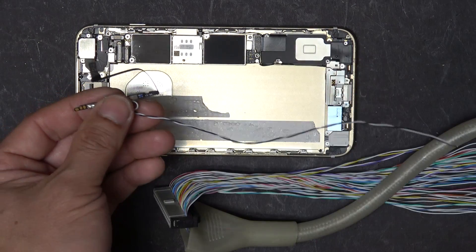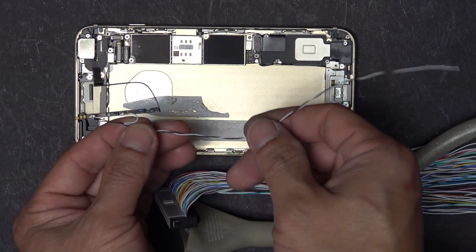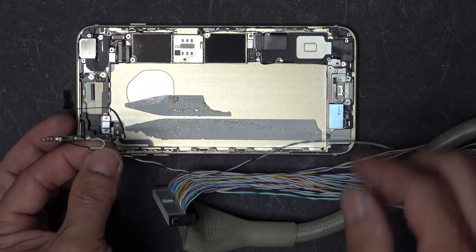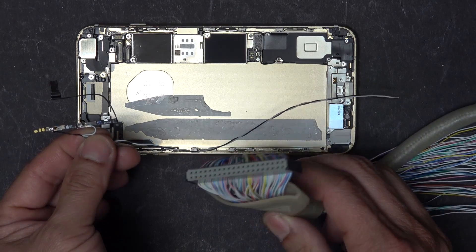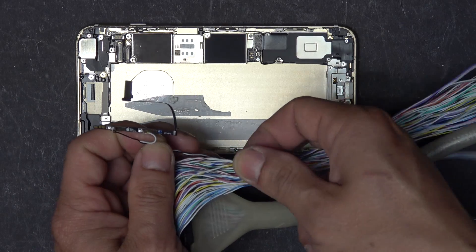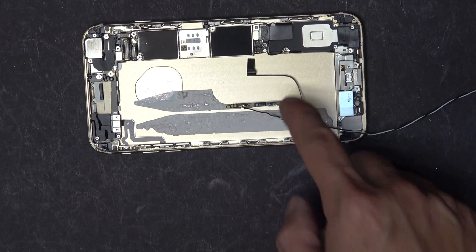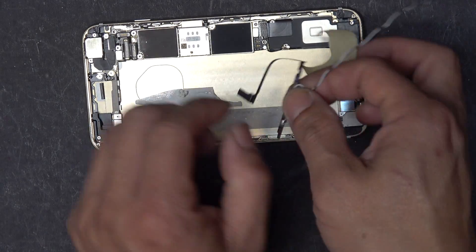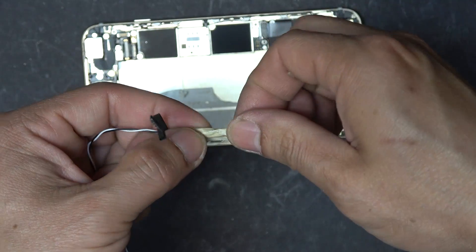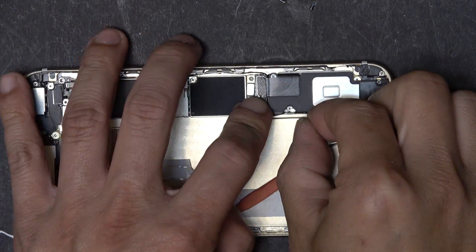That's where I connect to the external battery. Because the phone doesn't use a lot of current, I can afford to use a very thin wire — I want to use as small a wire as possible so that it doesn't look conspicuous. I use wire from an old IDE hard drive, which has very thin and small wires — perfect for this. The BMS is going to lay right on the aluminum, so I need to insulate it pretty good. I'm going to tape it over and then heat shrink it, then connect it back to the phone.